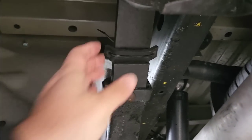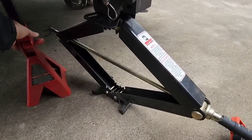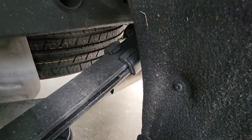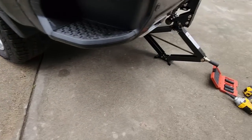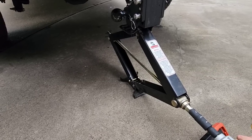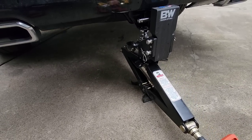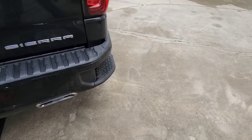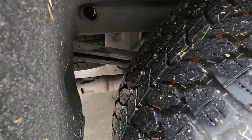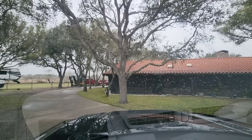So we have the zip tie in place and everything is really tight. We're going to go ahead and knock out the other ends of the leaf springs, and then we'll come back for some drive testing. All of them are done now. You can see them placed on all the leaf springs front and back. Let's get the truck lowered down. Hopefully this fixes the problem so I don't have to send my truck to the shop and leave it there, even though it's under warranty. Now all four ends are padded — it really expands that gap out a lot when you put that bushing in there.